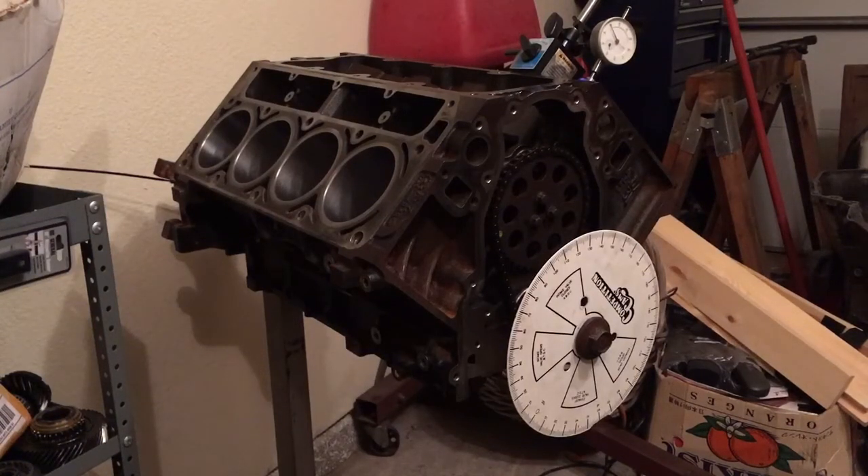I had a really interesting comment on my camshaft degreeing video. Machinery Repairman replied saying that I couldn't find true top dead center using my dial indicator — that you have to use the piston stop or positive stop method. I'm intrigued by his statement. Right now the engine is still set up exactly how it was when I made that video. I want to find out how far off it could be, because when you're degreeing a cam, one to two degrees makes a big difference.